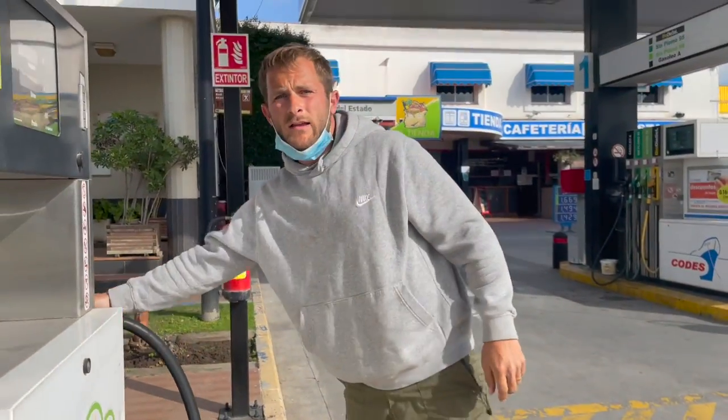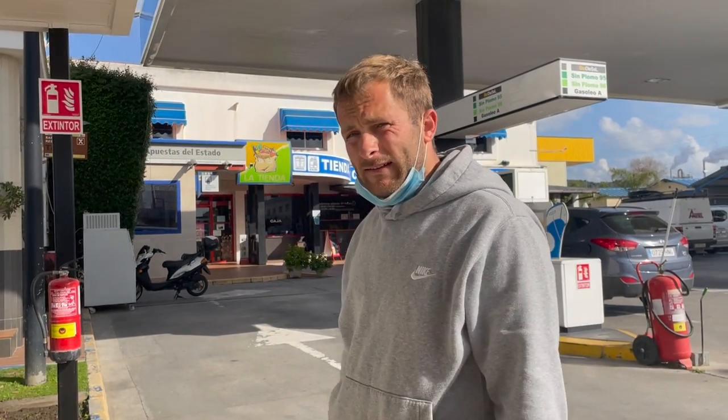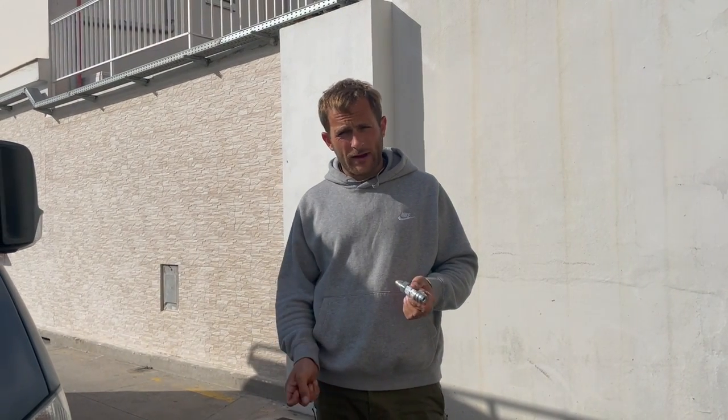That's how it's done. Very important to keep it at 80 percent of the cylinder. This is a 3.9 kilo bottle, so we can have roughly six and a half litres of gas. The most important thing to remember: once you've connected your adapters and connected the gas hose, open the gas bottle. In reverse, once it's filled, close the cylinder, undo the gas hose, remove your connector, and you're good to go.